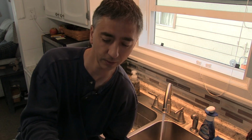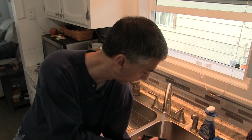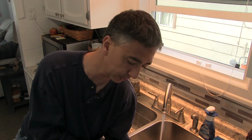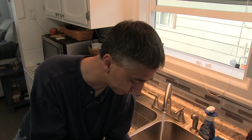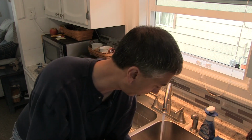One of the things about waterproof is that if you put the camera in running or flowing water or wave action, that momentary pressure can actually end up exceeding the pressure rating of this camera. So putting it under running water is bad. You don't want to put this under a pounding waterfall or something, because that can destroy the camera. And they do give instructions about how to store it, to dry it off and everything.